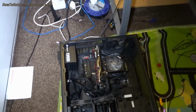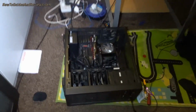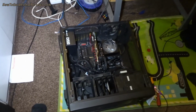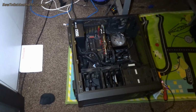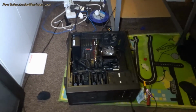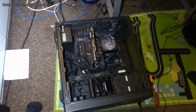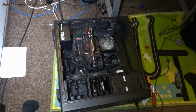On mine, it didn't show under storage devices, it showed under the NVME2 section config. But if you try to test it, it would crash. The system would hang and it wouldn't allow you to go past the boot screen, just as it's doing in this system. So that confirms Corsair MP600 NVME2 drives are garbage. Failed after 9 months, data loss. Pay 180 quid for this garbage. Take it out and hopefully your system works. Hopefully. Alright, I'm off then.